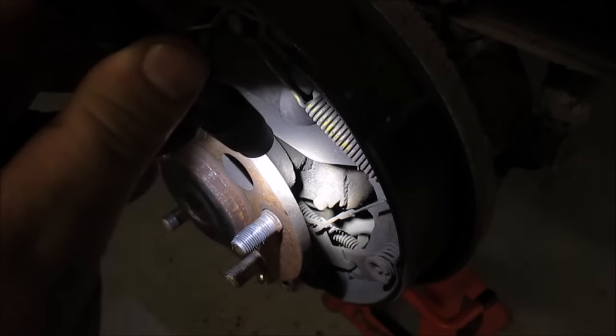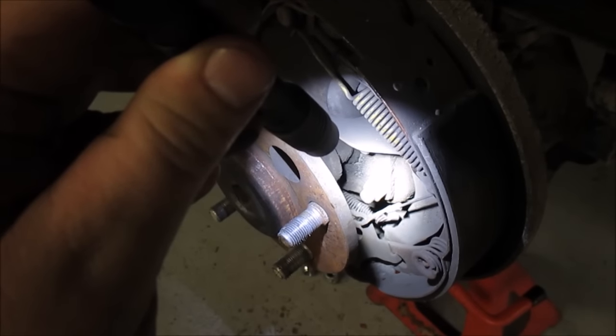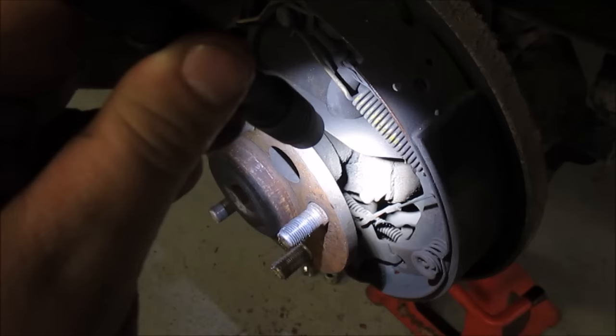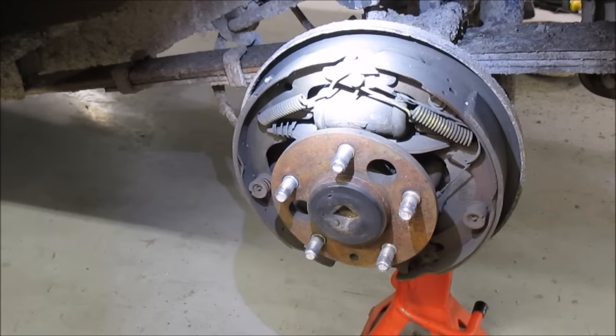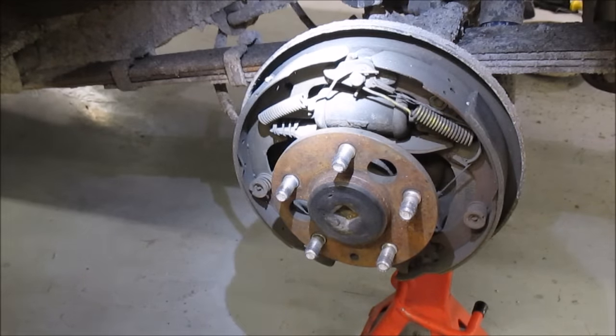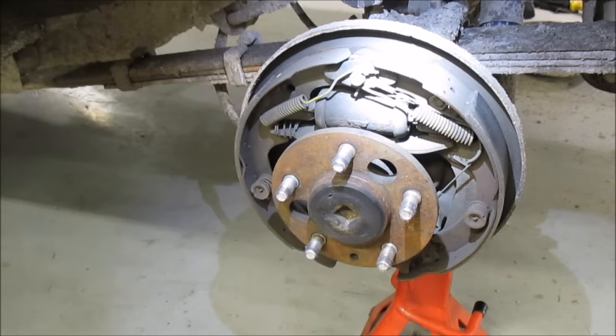In the opposite drum, however, it is working just fine. As you can see, the parking brake lever is moving correctly. To help you understand how this works, you can see that the brake arm on the right is moving. It is also moving the flat piece of metal that goes across the top of the axle that allows the shoes to compress out and apply the parking brake.